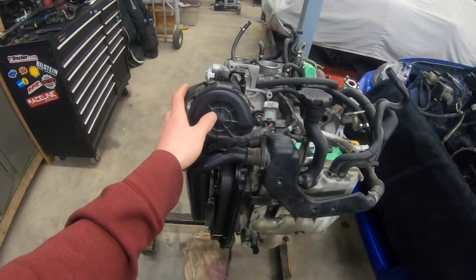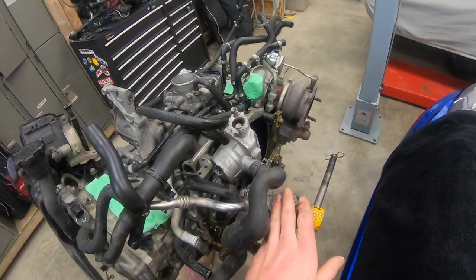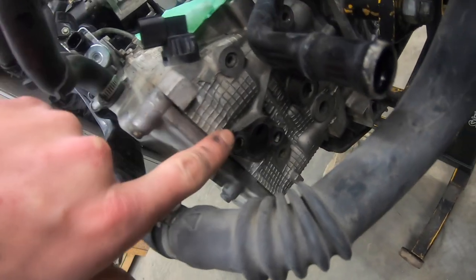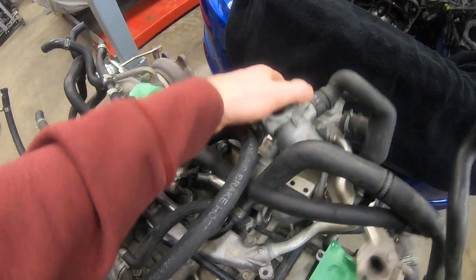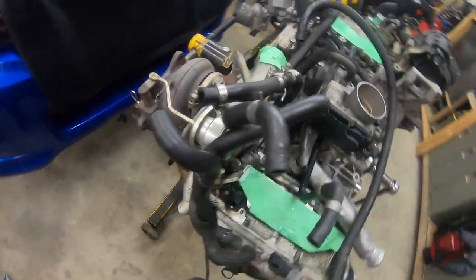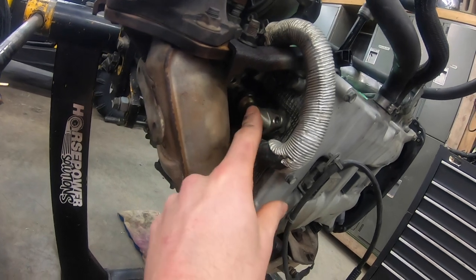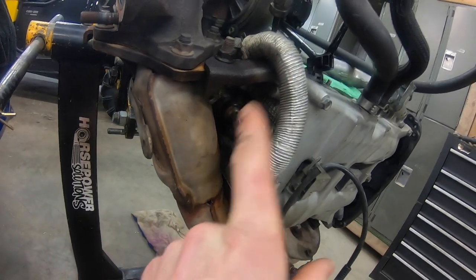So it consists of this front secondary air pump, these lines running down the side of your engine, which come up to these two air pumps here that have your barometric pressure sensors in them. This one has this hard line running down, which will connect to the back port of your head on the driver's side. On the other side, you will have a hose that connects to this air pump. This isn't exactly how they sit, but it's just for reference. You'll have this hard line down here that runs down your intake manifold out to the other side of your head, which is behind your up pipe on the back of this head right there. This is an absolute bitch to get at, you guys, if the engine's in the car and your up pipe is still on. It's a nasty job to do.